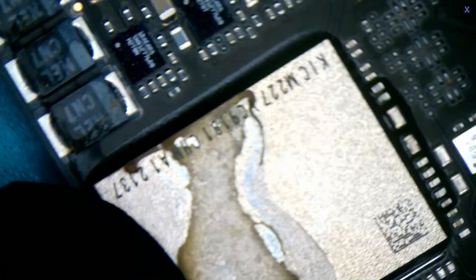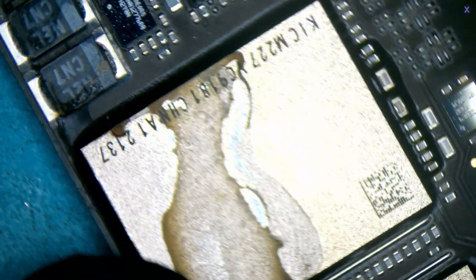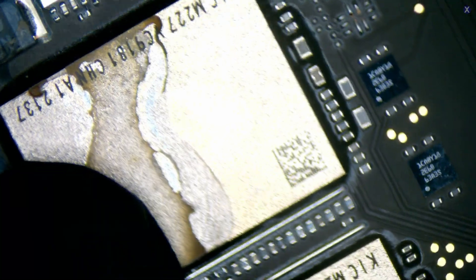Let me take a look at the NAND. One good thing that Apple does is they put this black coating that goes around the components on some — not all, but some — and that is to help against liquid. Part of that black coating probably helped out this chip, so the NAND didn't get hit directly. There's a little bit here too, close to this coil — a small resistor. Looks like it probably needs to be replaced. We'll at least clean it up. That's why we checked the whole board.